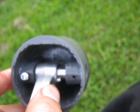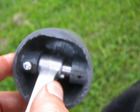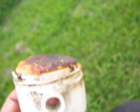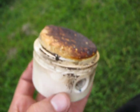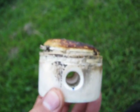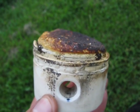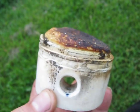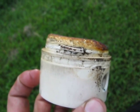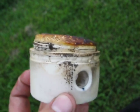It is fairly thick at the top — probably half to five-eighths of an inch thick. But in comparison, you can see what happened to the plastic piston. Again, this is the side that faces the spark plug, and it's severely burnt. The top ring has gone right down into the second compression ring area.